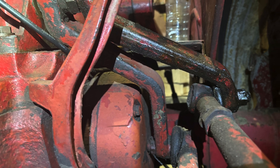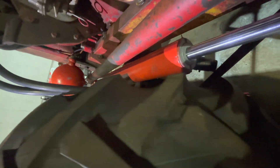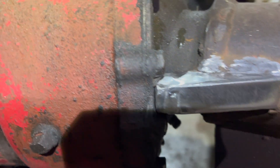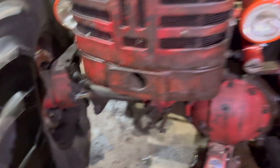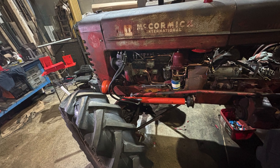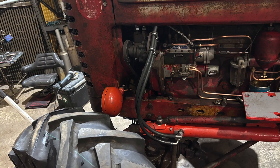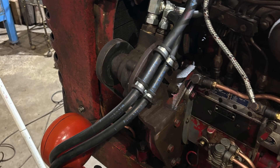In this picture the steering arm is not only lifted up but it's also moved further out, and the steering column arm moves further inside. I didn't do anything else with the steering ram arm, apart from the felt washers at the top and bottom of the ram — it looks like someone's used a bit of carpet there, but they do leak a lot of grease. So we'll weld a little bit of metal in there just to stop that — new bump stop fitted, just welded a bit of 10mm extra on. It seemed that every time you put the wheels in lock and turn them back again, the hydraulic hoses for the steering ram would catch with the wheel, so I moved them forward, and that extra little bit of plating was just perfect for adding the clips to hold the hoses and make them look tidy.